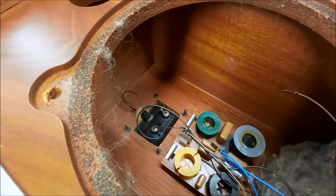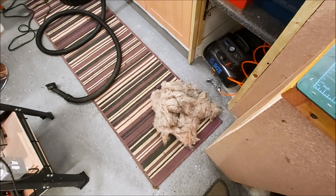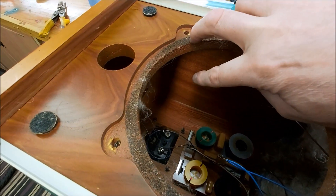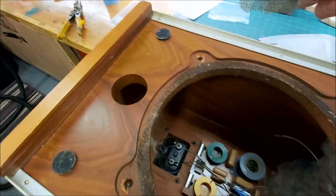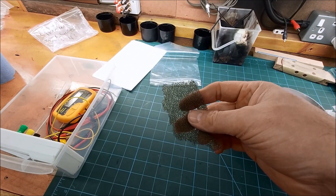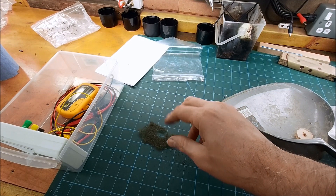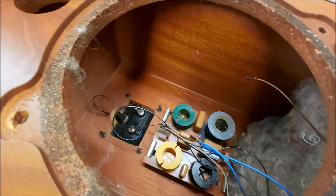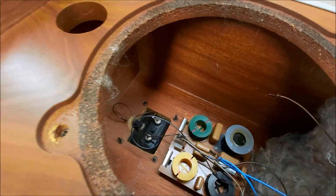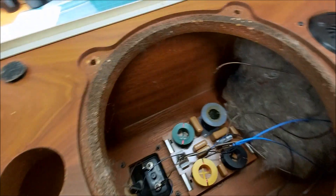These have a very low power rating — I think it's about 30 watts. There's a lot of wool inside — there's the stuffing I've taken out. When you take the woofers out, you'll find a foam mesh around the woofer, and when you take it out it just turns to dust. It's there around the basket of the woofer to stop the wadding touching the cone, but if you carefully dress it out of the way, that won't be an issue anyway.